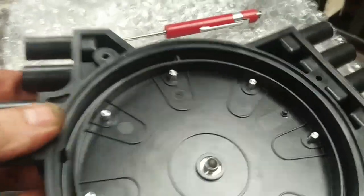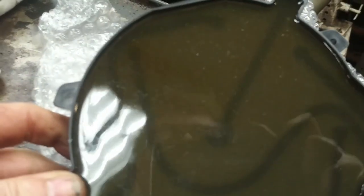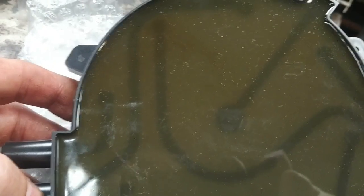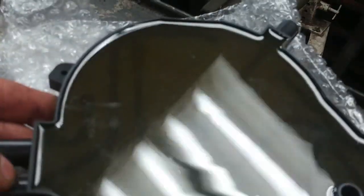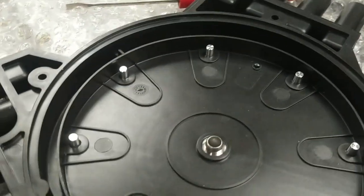This is the distributor cap, and it's in behind the water pump, as I mentioned previously. What can happen is the insulation quality can fail in the cap itself, and you can see the various internal conductors inside there that can actually cross conduct or leak through. Or we could have some moisture inside the cap, I'm not sure.